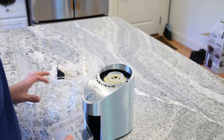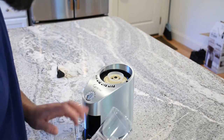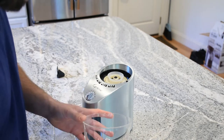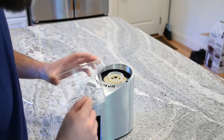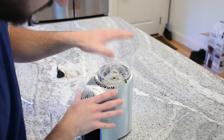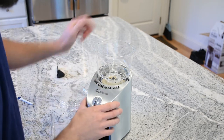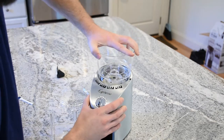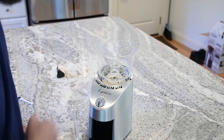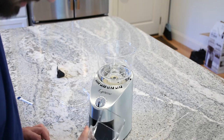So here's our machine. All of our parts are cleaned and ready to be assembled. This is called the bean container — I know I was calling it the bean cup when I was unpacking it, but I read the manual and this is actually called the bean container. It has a black dot on it. That black dot aligns with this black mark on the machine to insert it into the top and then rotate it. Where this black dot lines up on these different coarseness settings is how you control the coarseness of your grind. And then down here is the timer, which controls how long your grinder is going to run and feed whole beans into the burrs.